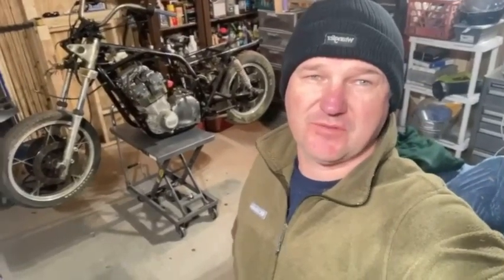So that's day five of our 1981 Suzuki GS 750L build. It seems like this was actually my fault — trying to manipulate a clutch that had sat for decades with dry friction plates. I should have warmed the engine up first before trying to work the clutch and it probably would have been fine. But it's not terrible to get in there and inspect everything anyway — no harm, no foul. It's going to cost us a gasket and I'll probably order a new set of needle bearings upper and lower for the shaft, just to have new parts in there since we had it open.